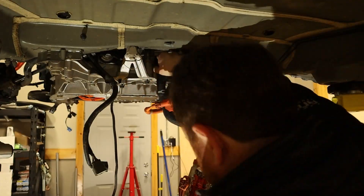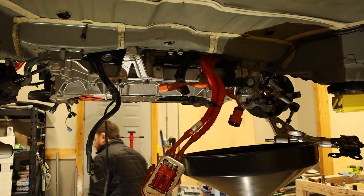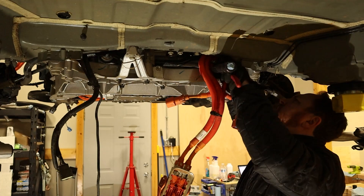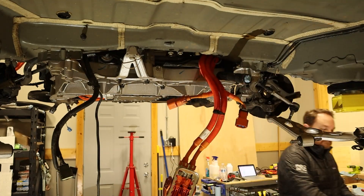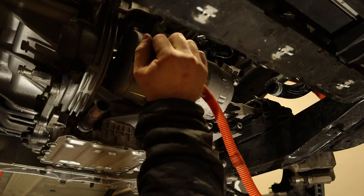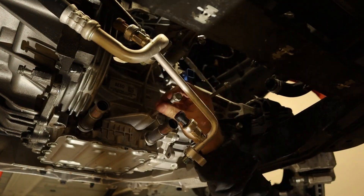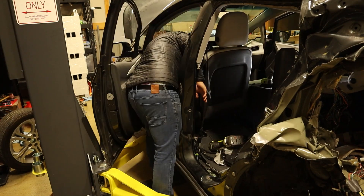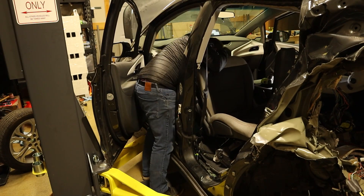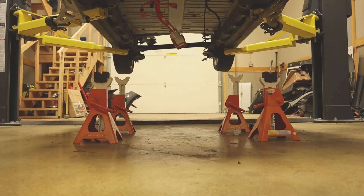At the back of the motor, I remove the battery coolant heater that warms up the battery when it's cold out, and a few wiring harnesses that connect to the battery. Up front, I then remove the AC compressor. This compressor is tightly tucked alongside the motor, and it is responsible for cooling the cabin as well as cooling the battery coolant. The last item to remove before dropping the motor is the seat — not because you need to remove the seat, but because you need to disconnect the steering linkage, and I couldn't get under the dash with the seat in the way.